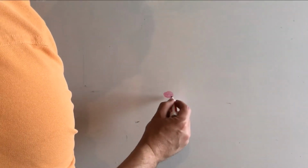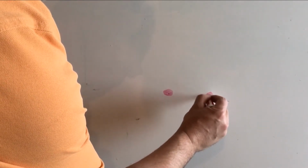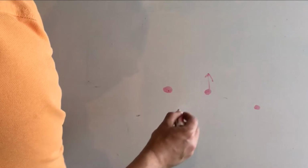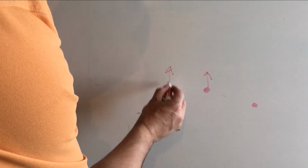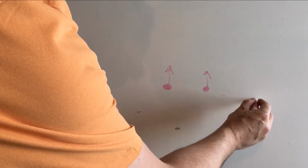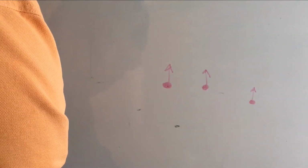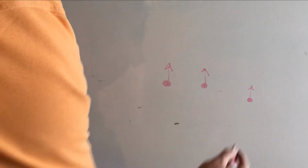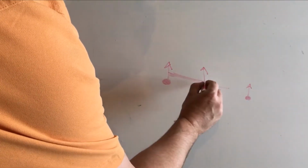You've got your engine here. This is your engine mounts. You have your transfer case mount, the transmission mount, which is held by your transfer case, and then you have your rear axle. So those are the 3 points you're touching. If you're going to raise this one, you've got to raise this one, so you keep this somewhat even. And then most likely you're also going to have to raise this one. Now you don't raise that one by changing your suspension, you raise this one by tipping it. So you're raising your engine mount to make up for the fact that you're going to want to raise your transfer case mount, so that you can still line up here and keep that angle going towards the back.